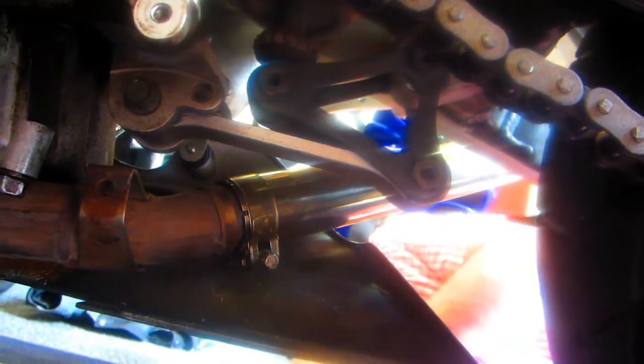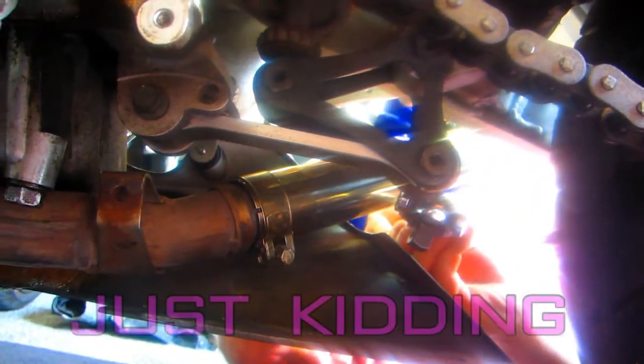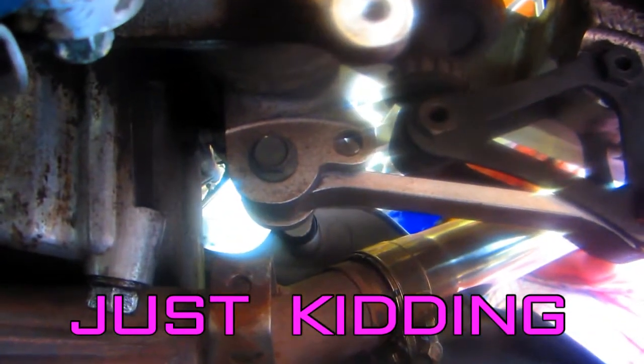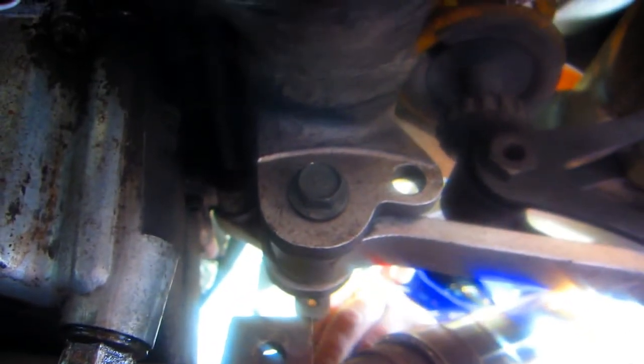Oh, you got it loose from that side? Yeah. Okay. See if you can tap the bolt out, but don't push it all the way out, just tap it. Oh, you know what you got here? This already has a lowering link on it. No. Yes, you do. You got an adjustment for a lowering link here. Oh, look, you already got... So, in a way, this has two settings, and it looks like this is on the high setting. We got it.